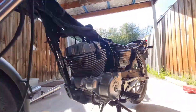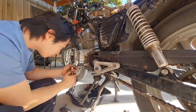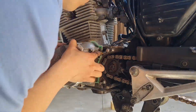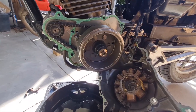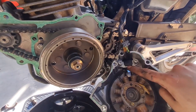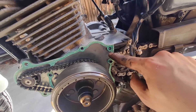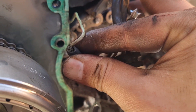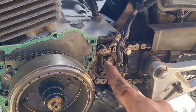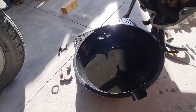That was way too difficult. Alright, let's take the side covers off now. So this is a little bit different to what I was expecting - I thought it was going to be right here but there's two things I'm looking at. It might be this little sensor here, or it might be behind here. I can see this cable is just a bit frayed, so I'm going to test this cable first and see if I get any reaction on the neutral light. Also check out this oil - it's so watery, definitely need to change that out.